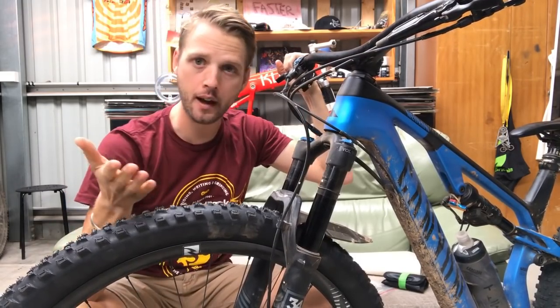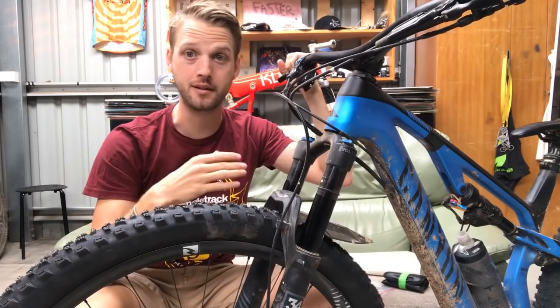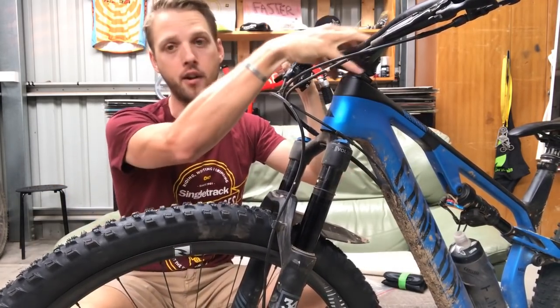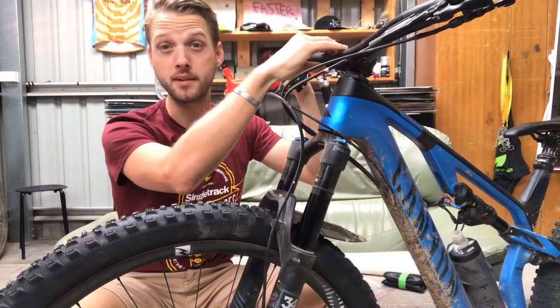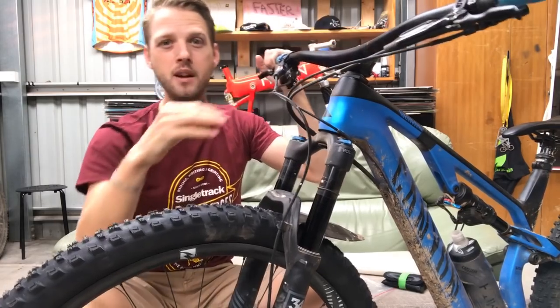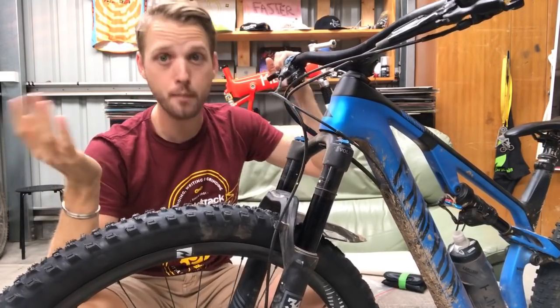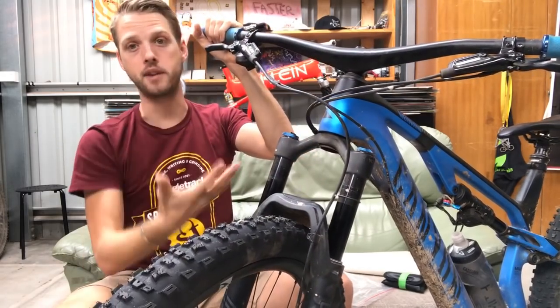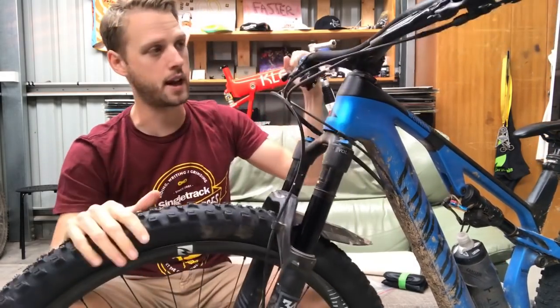But if you're building a carbon handlebar and it's going to be bolted onto any one stem, then you obviously lose control of that particular area of the handlebar. Some stems are wider, some stem faceplates are narrower, some are 4-bolt, some are 2-bolt. Some are alloy, some are carbon. So by building all as one piece, Syncros has more control over the end ride feel. So that's kind of the advantage there.